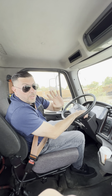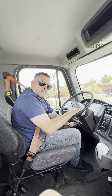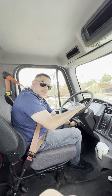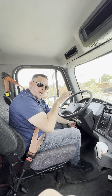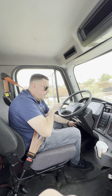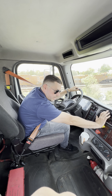This is the most important part of the test — you can't mess this up, there are no second chances, but it's very simple. You just have to remember to do these simple things. When you turn off the truck and turn the key to the left, hold your hand on the key, then turn it back to the arm position. That gives it power — don't forget to do that. Shut it off, turn the key. Right after you do that, you must release these brakes — push them in. Press firmly with your palm for three seconds: one, two, three, then the trailer.